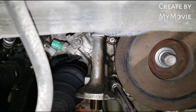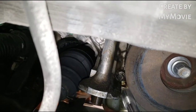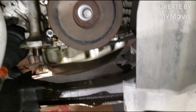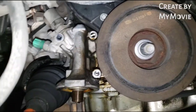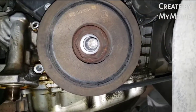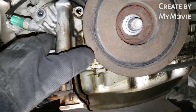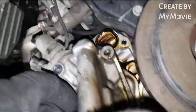We're ready to remove the oil filter housing unit itself. We've unplugged the oil pressure sensor or switch, and removed the three bolts which are size 12. You'll notice one of them is longer than the other two — two are the same length and one is not. Now we're pulling this off and it looks like there's one more plug.